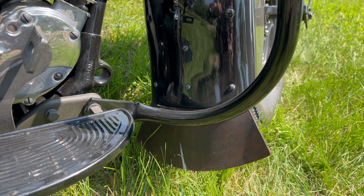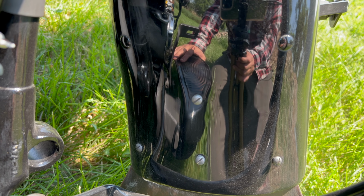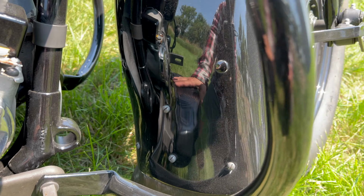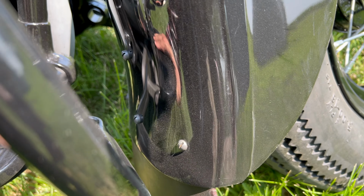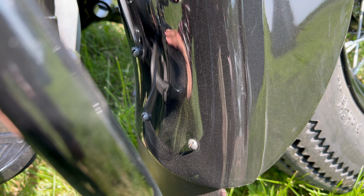The mud flap is made out of leather rather than being that laminated canvas one like what was used 36 to 42 and sometime in 46 or 47 and later. So it's really cool. This is the correct screws. It's two 12-24 Philips head screws in the center, and then two 10-24 round head screws on the outside.